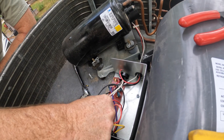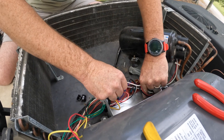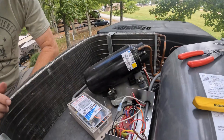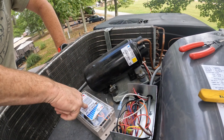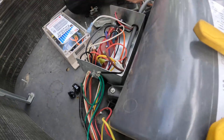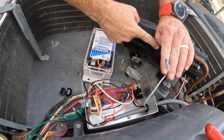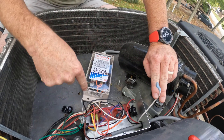Now what they want us to do is unplug this connector here. I'm going to hold this board down and pull this up — we're not going to get rid of it yet, just pulling it up and out of the way. This is where I'm going to mount the Easy Start; it has double-sided sticky tape on the bottom. I ran the wire around and underneath the compressor and came into the same hole as the compressor. There are four leads here. Our first step was to unplug the white wire from the compressor and then plug the white wire from the Easy Start into that same location.